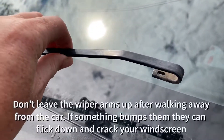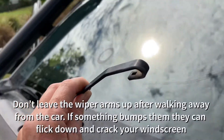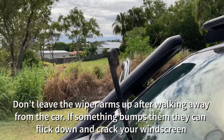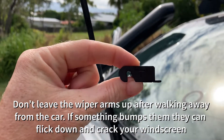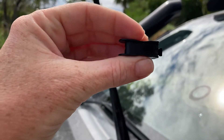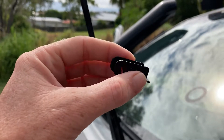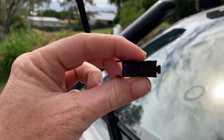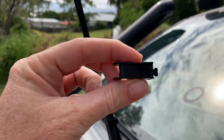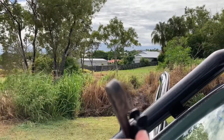Once you've taken your wiper blade off, you'll be left with your wiper arm and the little hook at the end — just fold that up. Now this is the clip. Different brands have different numbers on them; this one here has got D2. To know which one is the right one from your pack, most of them have a slightly different width at the top, so one will clip in and one won't.